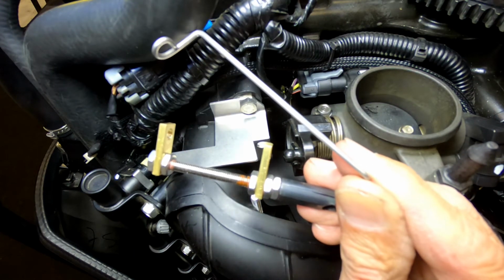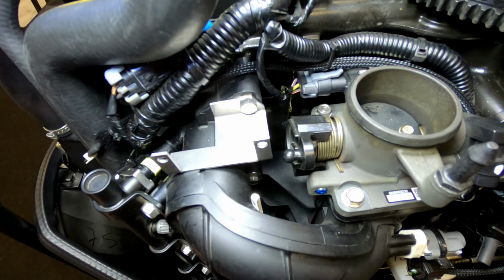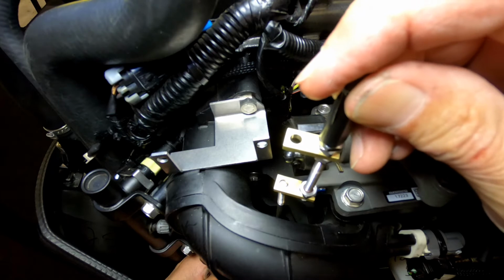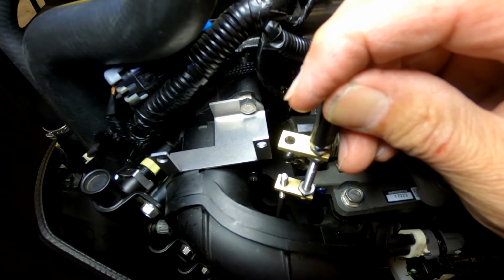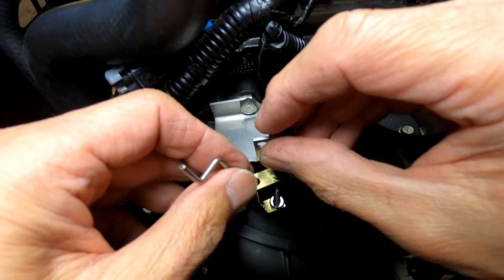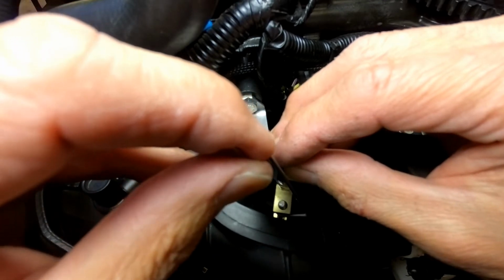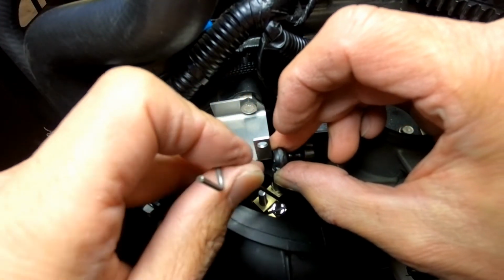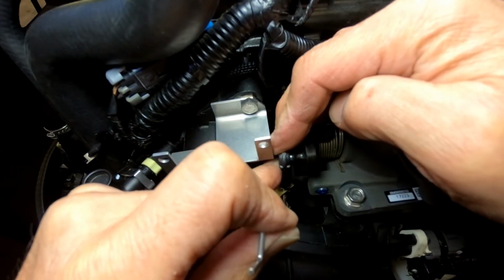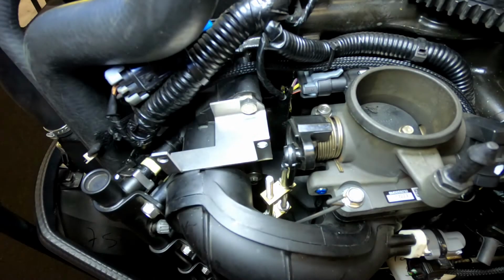We're going to install the slip assembly and the push rod. With my left hand, I'm reaching through the intake manifold to hold the throttle rod out. Now I'm slipping the first slip block over the throttle rod, then the push rod, and then the second slip block. Keep a hold of the push rod, pull rod, in case you drop the slip assembly, you'll be catching it with the pull rod. Now snap the ball end fitting over the ball joint, and you've successfully installed the slip assembly.